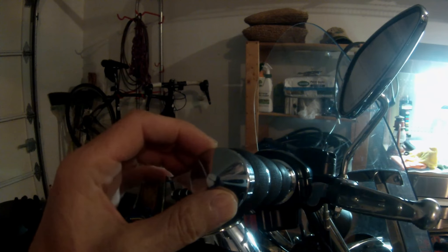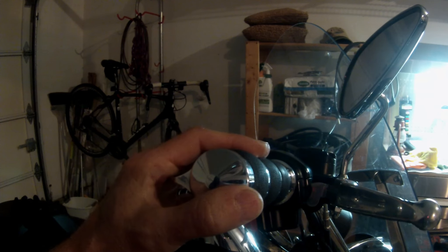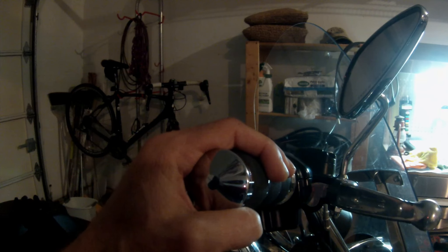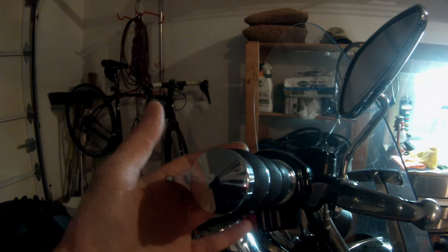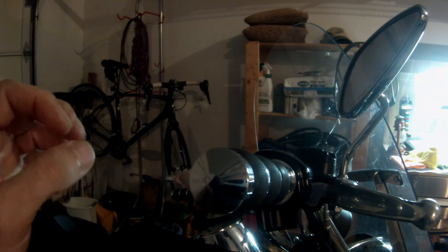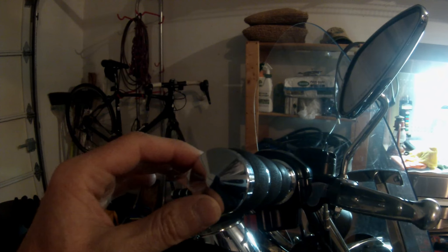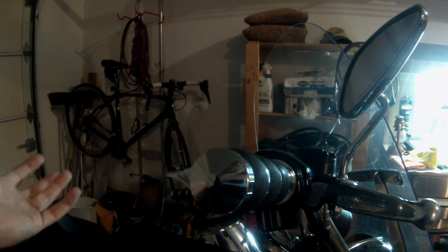As I got close to the back of someone's bike, I was rolling on and then the bike sped up more than I expected. It turned out OK. This was advice I had gotten from a dealer who had serviced mine: when this starts to stick, unless there's debris — which there shouldn't be because it's all sealed — if you've had a lot of miles on it, it's time for replacement. Don't lube it to get more use out of it. It's wearing out — that was a fortunate lesson learned.